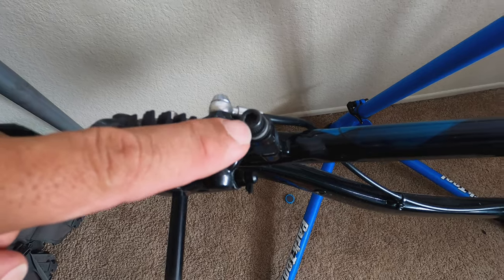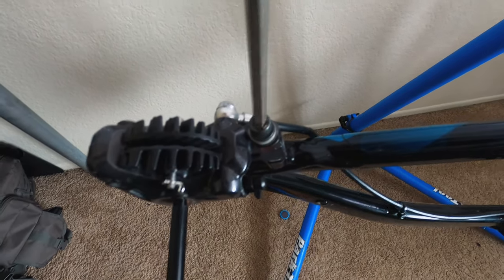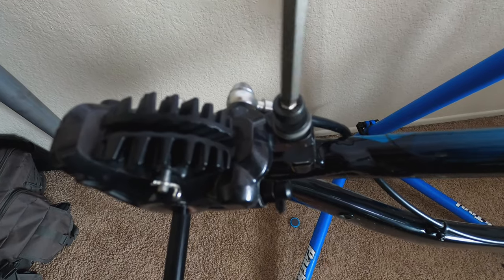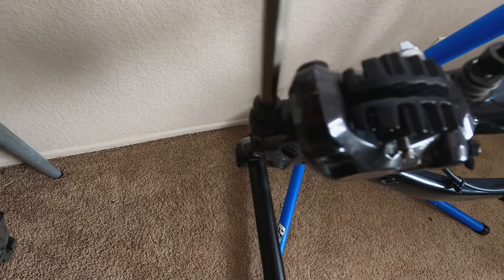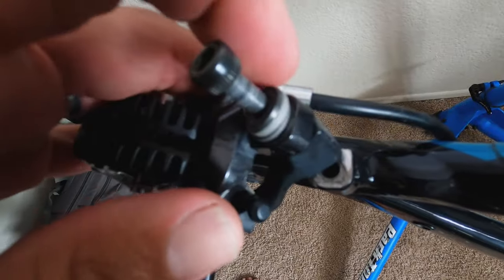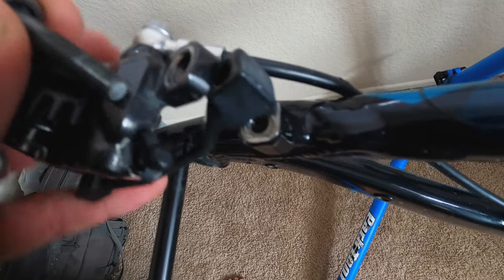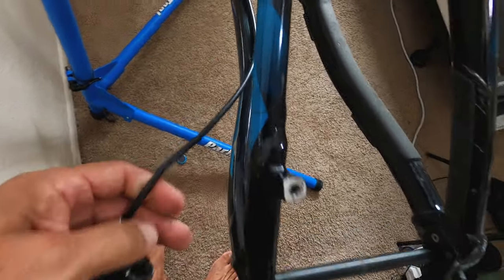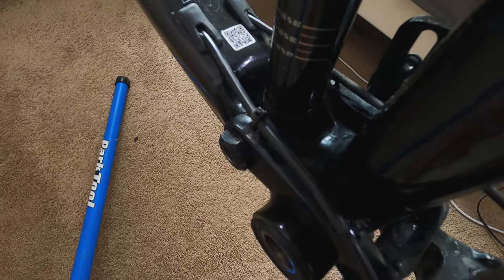To remove this bolt and this bolt from the frame, we're going to be using a five millimeter Allen key. Just going to loosen that up and loosen this one. There's going to be a bunch of extra little washers and pieces in here between the bolt and the actual brake itself, and then also you have your adapter just underneath that. So now we have the rear brake off of the frame, but we do have a couple of small zip ties here holding it to the rear triangle — one, two, three, and four zip ties. We're going to cut those and go from there.